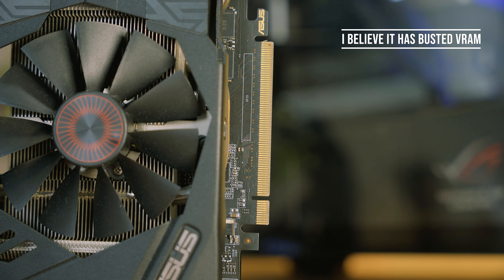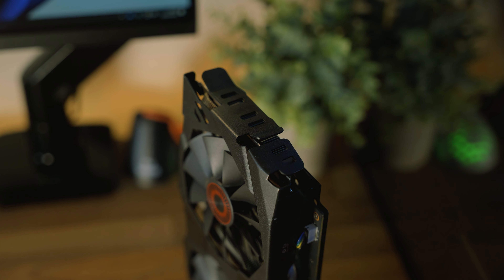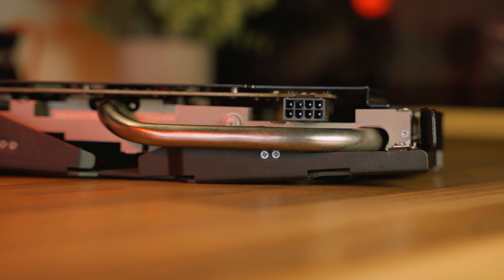Just look at the untested GPUs I've run into over my time running this channel. This GTX 970 — I'm pretty sure it's got busted VRAM, because whenever I install the drivers it just turns the PC completely off. I reckon the VRAM's busted, or it might be a dodgy V-BIOS — I haven't tried flashing it yet. The GTX 770 I covered also had busted memory and just couldn't be brought back at all. With 900 and 700 series cards listed as untested on eBay, VRAM problems are quite common — the VRAM on those cards wasn't exactly reliable.